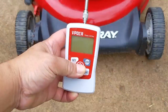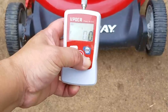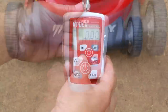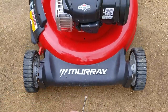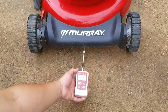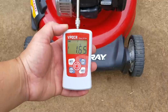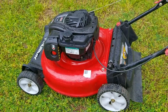Now I think it's time to show you what I have planned. This is a push-pull meter, and the last time you saw it I was using it to measure the pulling power of different types of self-propelled systems. For this one, I'm going to use it to slowly pull the mower a short distance on the concrete and find out how much force it takes to get it to start moving. The display says it took 1.67 kilograms to get it to start to move. Just to make sure the reading is consistent, I'm going to do that test one more time — and this time I was able to get a reading of 1.65 kilograms, which is not much different from the first reading. I should have taken a reading before we lubricated the wheels, but since this mower is not self-propelled, I don't think it would have made that much of an impact.